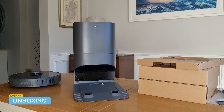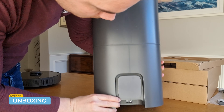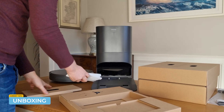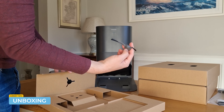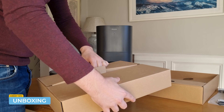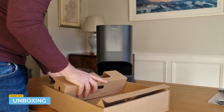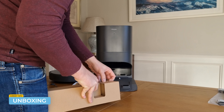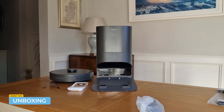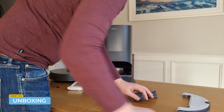On the navigation side, there's a LiDAR unit at the top constantly spinning and mapping out the territory, while there's a 3D obstacle sensor at the front which dynamically avoids cables or anything laying on the floor. Within the app you can set no-go zones or do-not-cross lines for areas you want the robot to avoid. You can command it with Alexa as well as remote control via the app. LiDAR can work in dim or low-light environments, unlike V-SLAM technology used by some competitors, which relies on a camera built into the bot. There's also a cliff sensor at the front so it doesn't fall off from a height.